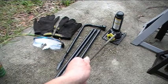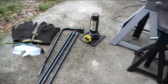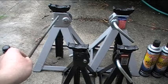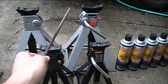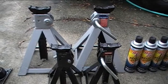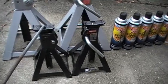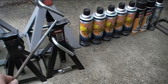I have the jack, which I'll use to raise the vehicle. And I have two sets of jack stands. I have these larger ones — these are six-ton or 12,000-pound capacity jack stands, and those I plan on using under the front of the vehicle. And then these smaller ones, which are also shorter — these are two-and-a-quarter-ton or 4,500-pound jack stands.